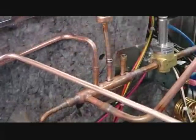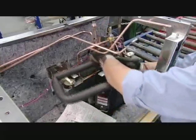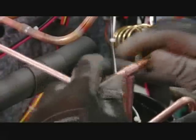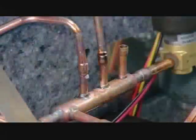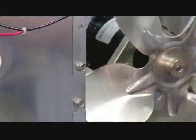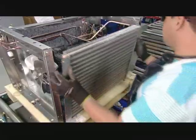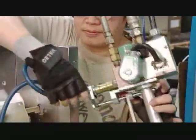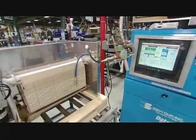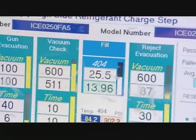The compressor will force refrigerant through these pipes in a continuous cycle of heating and cooling to eventually produce ice. He brazes the joints to seal the connections. He attaches a fan to another side panel — it will blow cool air onto the radiator to cool the refrigerant and help convert it back into a liquid. Now he pumps the refrigerant into the system and measures the flow to ensure it receives a precise amount.